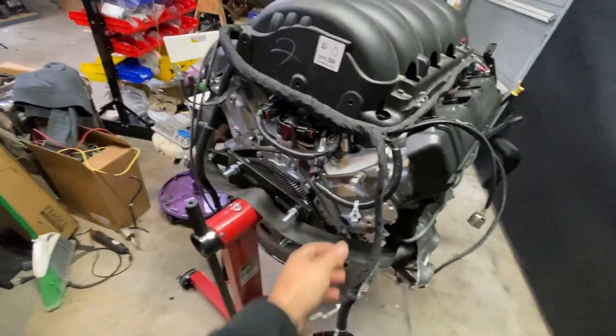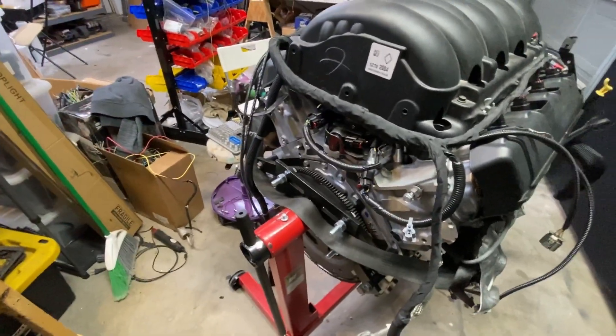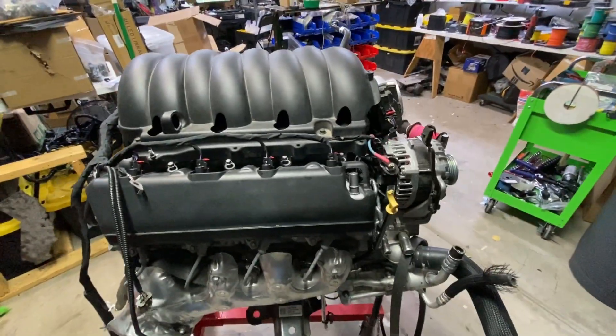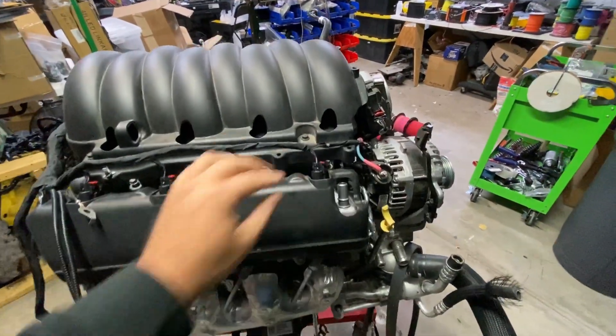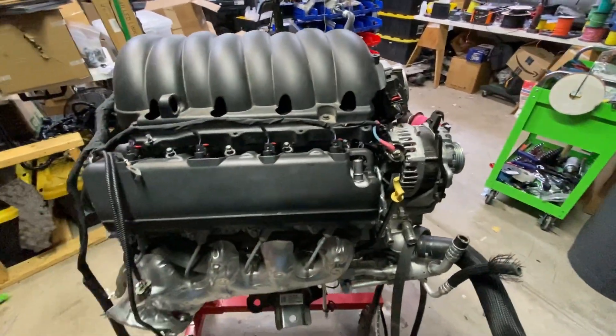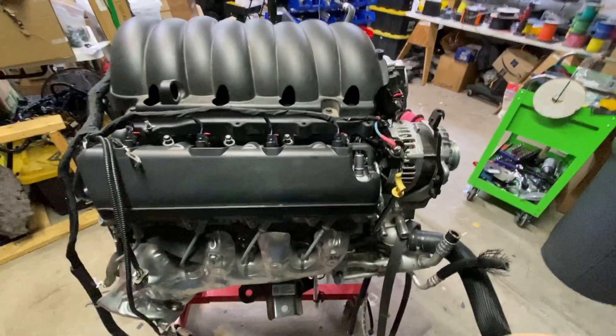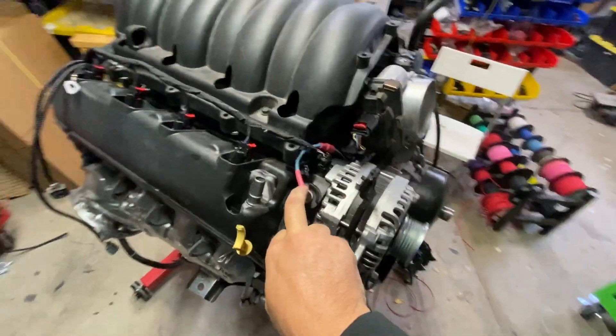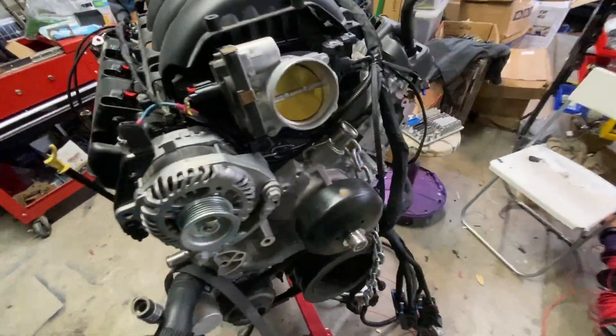California is its own special entity. Next, this is a brand new GM harness that I take apart and rebuild. It grabs power from the alternator — I'm running a 10-gauge wire — and it makes its way to the fuse panel.